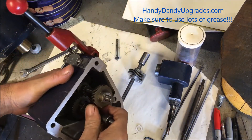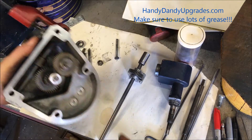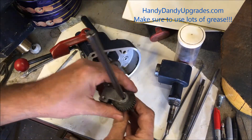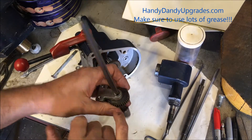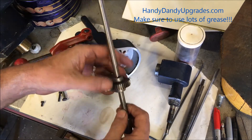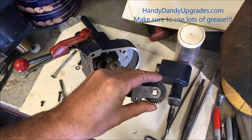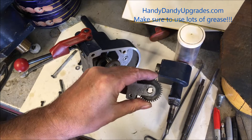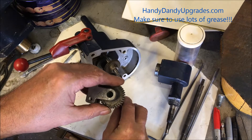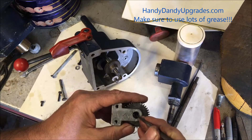This shaft — this is a trap gear. There are two roll pins captured by two washers in this gear, and they slide down this shaft, and that's how this gets its name: it's a trap gear. Putting this in, you've got to have everything lined up. You can see there are two little pins in there. This thing slides right in there. You need to make sure the pins stay in place.